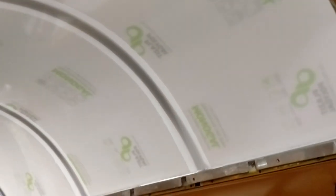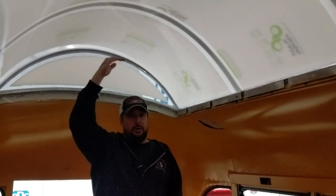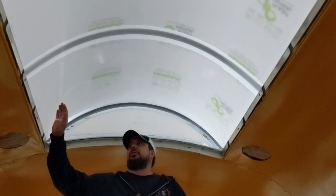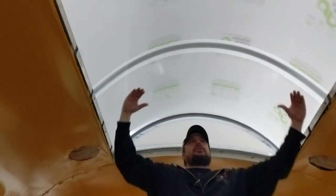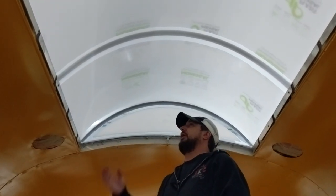Above us, the fabrication guys got a sweet atrium roof going. We've talked about this roof in detail before, but now that it's in you can get a better vision of it. We've got a ton of headroom up here. We've got a hammock that's going to go from here across the bus, so you'll be underneath it looking up at the stars and the sky. Going over how this thing was made: this is aluminum, with one big sheet of Lexan. There's a channel built in that locks the Lexan in — it's basically a drop-down where the Lexan is forced in, trying to have as little aluminum visible as possible for a clear view.